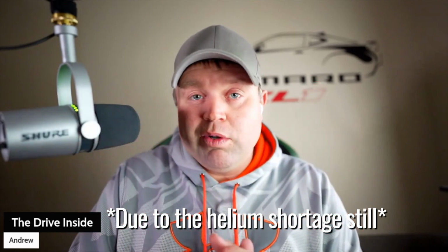My welding gas, for those of you that want to MIG stainless steel, I'll give you a shortcut. If you can get your hands on some tri-blend, I think it's like 90% helium, 8% argon, I can't remember, I think the other 2% is like CO2. That's the best. I did have to settle for some Stargon, because I wasn't a commercial business or a big welding outfit. So my welds will come out with a little black burn to them, but they told me it'll wipe right off. They said that's just the CO2.